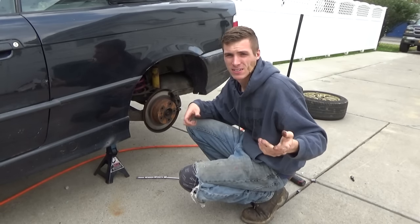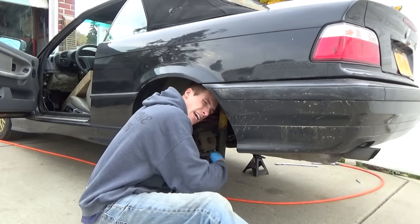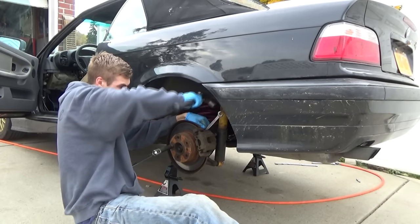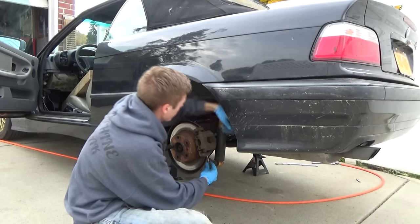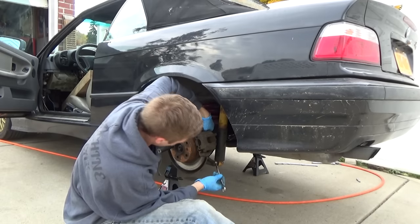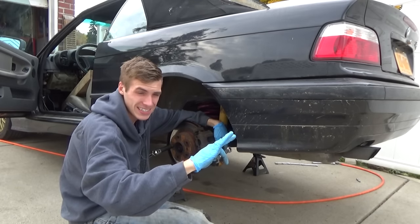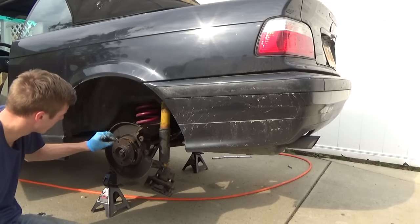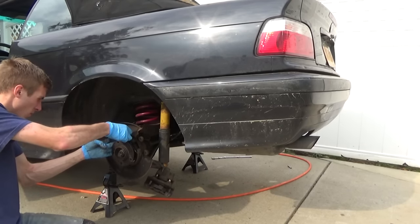As you know, we're missing one bolt — otherwise it'd be five to go, because there's six of them. Math. There's something funky going on with the e-brake, so I just want to investigate that. I have to take the brake caliper off to take the rotor off. It's a beater though — stuff's gonna break. Maybe one day, if we fix enough stuff, it'll just work like a top. Well, I'm glad I looked into that. This pin came off — this hangs on to the emergency brake, the real emergency brake, not the one I installed. Just got to button this up and we'll be good.